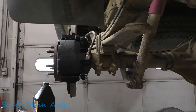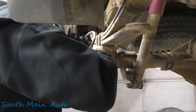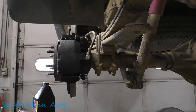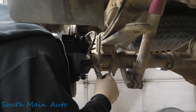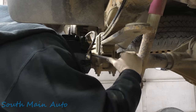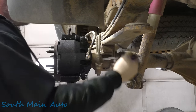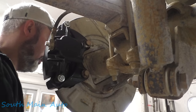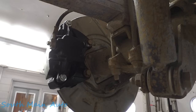And one thing we didn't do is check to make sure that the reman caliper had a working bleeder. That may sound silly, but we've had them come in stripped out, snapped off, non-functioning. This guy just went to try to tighten it. All right, this one works, opens and closes. Hooray. Whoa, whoa, everything's hitting the floor. Son of a...